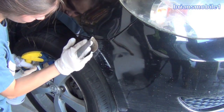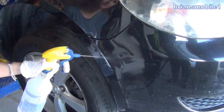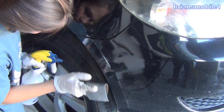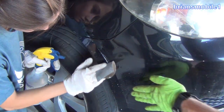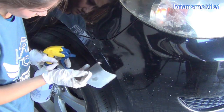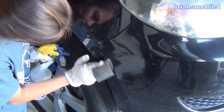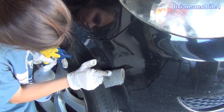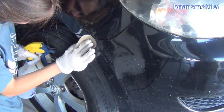You've got to be careful with some bumpers — you'll have a light-colored bumper with dark paint on it, so if it's getting lighter and lighter instead of darker and darker, back off. The nice thing about black is it is the easiest color to match. You can use gloss black engine paint and touch it up by spraying it into the cap, brushing it on, and then wet sanding it down to smooth. She's being really careful because if you get on the ridge you can take off too much paint. The whole point of wet sanding is to remove material. There's white paint transfer from maybe another car, and we're just taking that off with the wet sandpaper — that's going to leave the paint really dull. Now I'm going to go back with the buffer and some compound to get the shine back. That looks awesome.